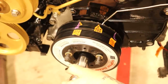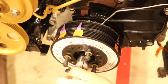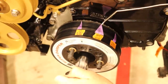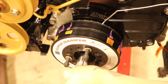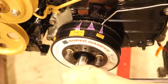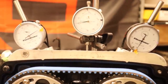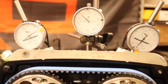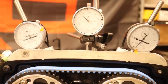Here you can see the very accurate sticker markings that I've made on my harmonic balancer. This part can be a little confusing, so if you have any questions please let me know in the comments below — I will make a follow-up video. Basically, the first thing I'm going to do is find the exact true centerline where I'm at currently with both intake and exhaust cam. I'm not just going to look up the specs or assume it's OE — I just built the cylinder head, it is not fresh at the factory, there could be some human error, so I'm going to verify it. Much like verifying TDC, there's that point of dwell when the cam lobe is pushing down on the lifter where the dial indicator will pause, so we can't identify the exact true center that way. What I'm going to do is choose an arbitrary marking on my dial indicator that is convenient and easy for me to mark both forward and back.